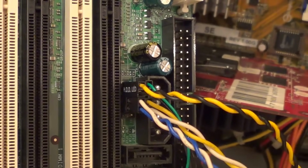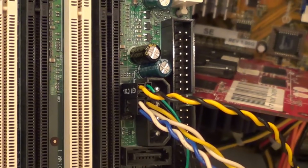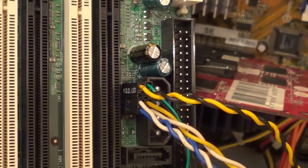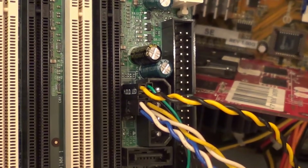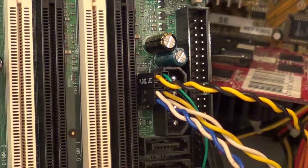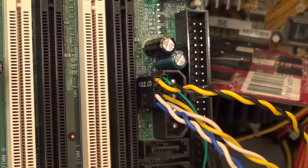So at least you know that if you do plug one of these connectors onto the correct pins but the wrong way round, no harm will come to your computer. This is true for these 4 connectors only. Plugging in other connectors incorrectly may cause harm to your motherboard.